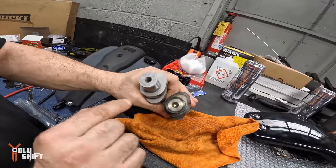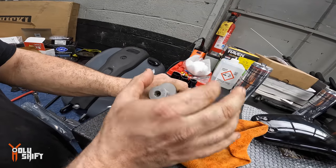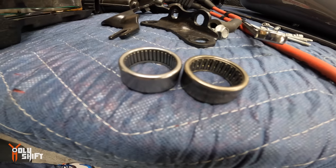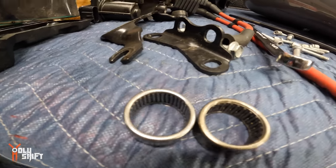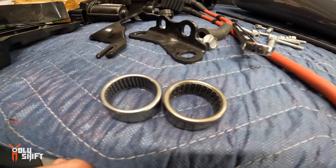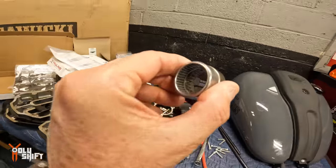Your base circle is the same down here. That's why I can use those push rods, but look how wide and tall. How many rollers? There's double the amount of rollers over here inside compared to here at the stock. You see it, Hector? Yeah, I see it.